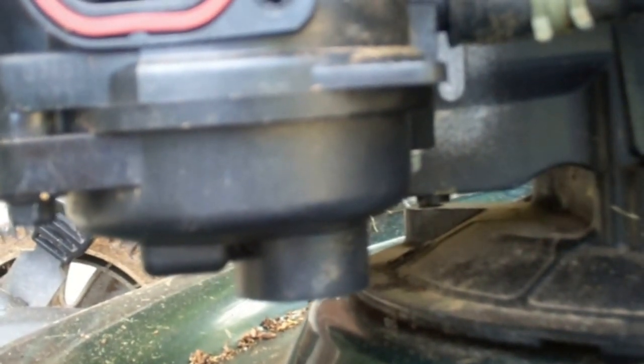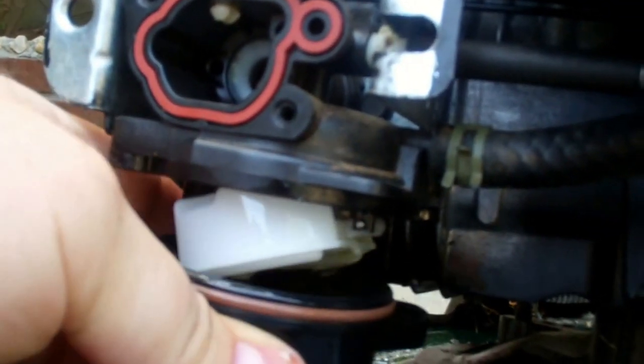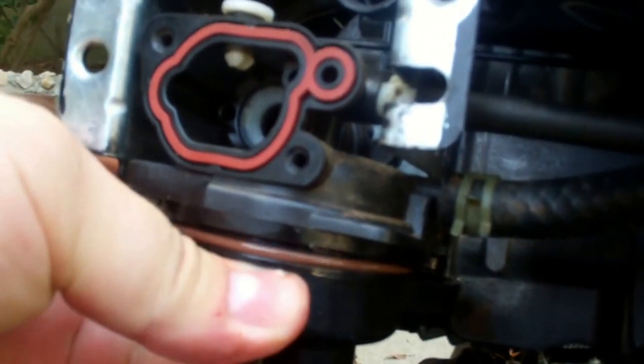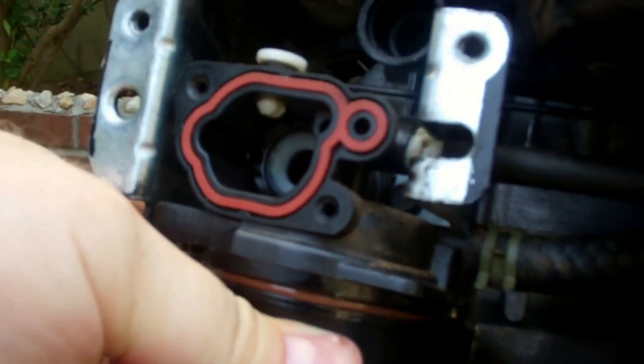So I guess I'll be trying to take that off, and of course it's not an easy spot. 9/32 is the size of the screws, but you know, I can't get my screwdriver up under there, so I'm going to have to find a wrench or a socket. I'm trying not to make too big of a mess, but I mean, I've obviously got gas in here. The float seems to be working fine. I'm just leaking gas everywhere, so